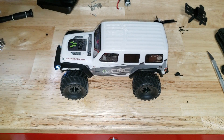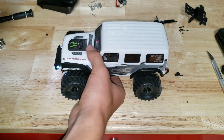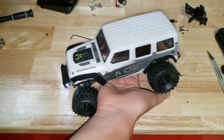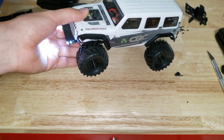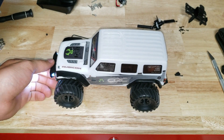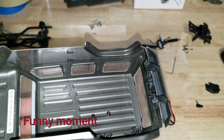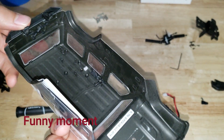I'm guessing it's a lower turn motor, because the stock motor is an 88 turn - I'm guessing it has less turns. But let's see the torque. Oh yeah, plenty of torque though. Well, there you have it guys - maybe an upgrade? Who knows. We'll see how long this motor lasts, and if it lasts for a good while then maybe we'll get one for the other truck. If you don't have a container to keep all your screws and stuff, the body works pretty well as one - just a little tip.